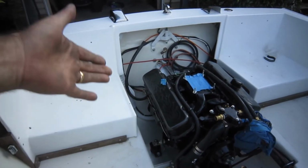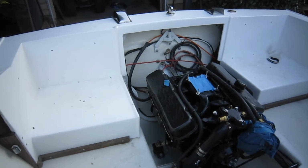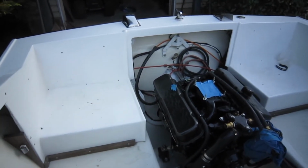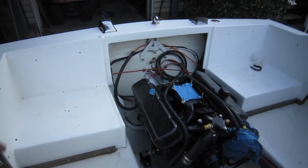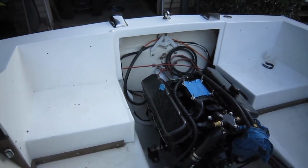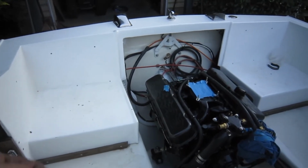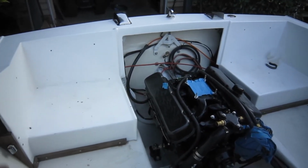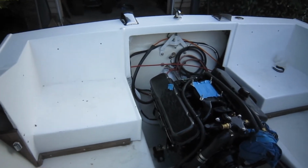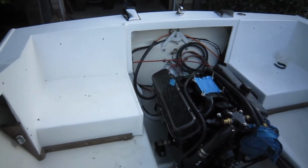That would have been a long day of driving that thing in and out, in and out, in and out. And this back one was giving me such a hard time that I had to use an old boater's trick for fiberglass when putting screws in. If you've got a real tight one, you put a little soap on it, so it'll use it as a lubricant to go in. Worked perfectly. Once or twice, just put a little Dawn liquid soap on it, and it drove right in.